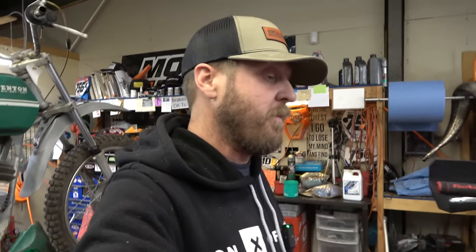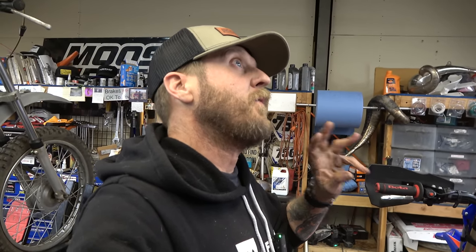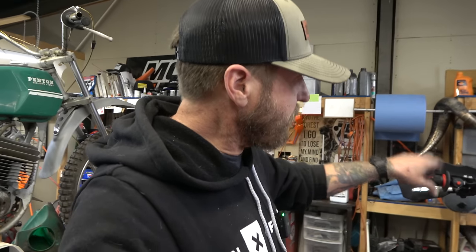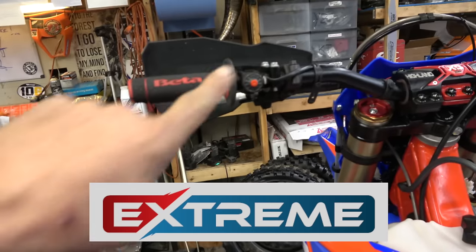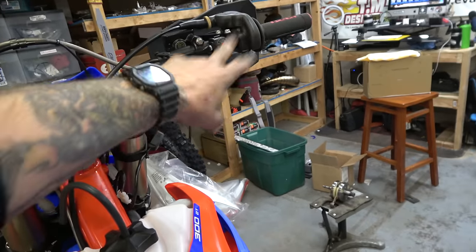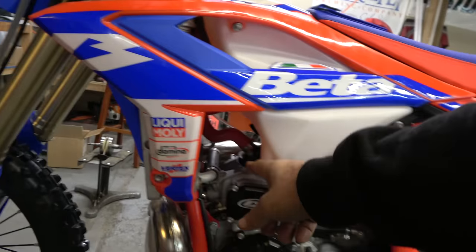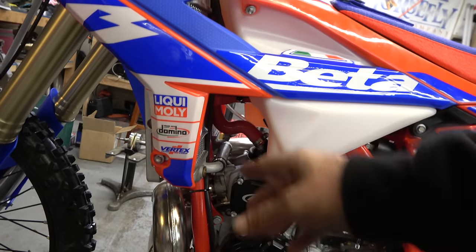We jetted the carburetor. We went with the NECJ needle and 40 pilot, which is one up, and then a 158 main, which is down quite a bit. So 165 is stock. Buttons. We got a start button here, kill button over here. For the OCD people, we'll try to square that up. But so yeah, kills over here, starts over here. Deleted all that junk that was there. Put the Samco hose, got rid of the thermostat. Really happy about that. Cleaned that up a bunch.